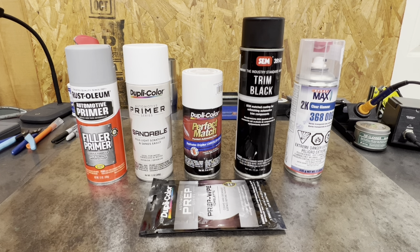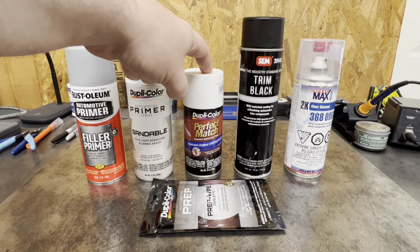If it's just a perfect finish, we'll come back and just hit it with ultra fine wet Scotch Brite. If we've got imperfections — I know I have one little sag on a fender where I had to cover up a pinhole — I will have to sand that with a little bit of sandpaper first, but no big deal. Take your time with all these things. The next product we'll put on the truck is going to be this Duplicolor Perfect Match.